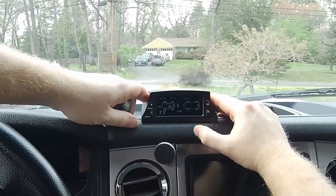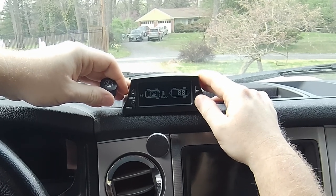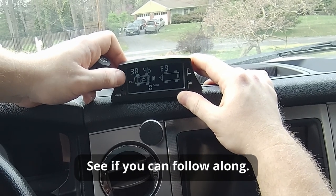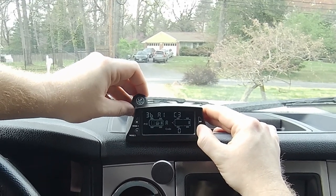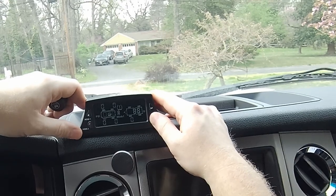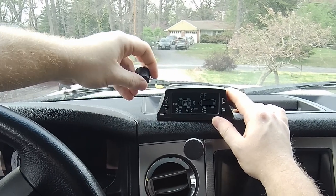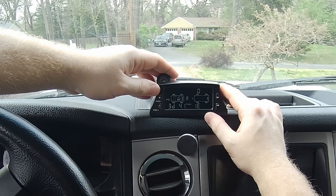Let's try the left front one more time. The ones with the circle will be the trailer. So we'll push and hold the code button again. Left front — let's go. So that's left front. I think you only have to do that once, and then you push and hold code until it starts screaming at you because you've got, in this case, four flat tires. I think this is a pretty realistic example of what you have to go through to get this thing programmed and how frustrating it can be until you get the hang of it.